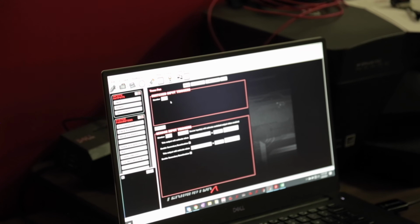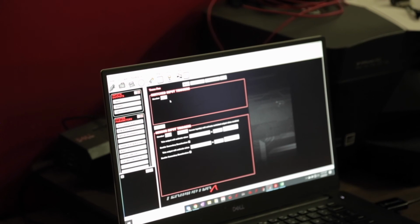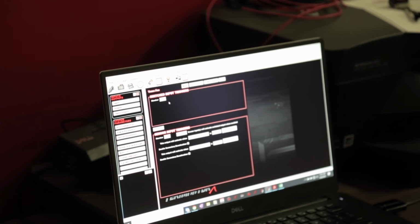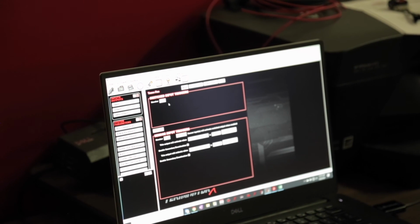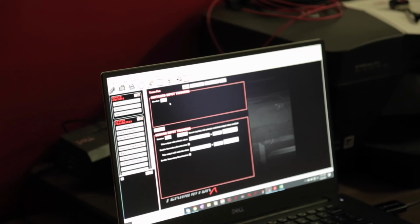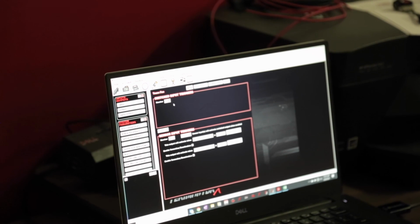In the future here, we will have all this support within the handheld, the 3.5-inch touchscreen, where the wizard will pre-populate the tables. It'll ask you what type of engine it is, a 5.7 or a 6.4, and it'll automatically populate the SRV valve and the VVT solenoid pin to the correct pins on the pin map, so it truly will be no laptop required for VVT support here in the near future.